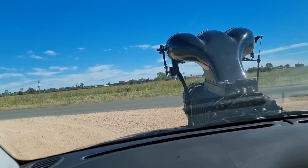Alrighty, so we've just put the new flange and new nut on and tightened that up, and we've put our locks here on. This one here, we had to tighten it up a bit more, didn't we, because it wouldn't line up. Put our rear bush in, ready to go in. Alright, let's stick her in the car, Mickey.